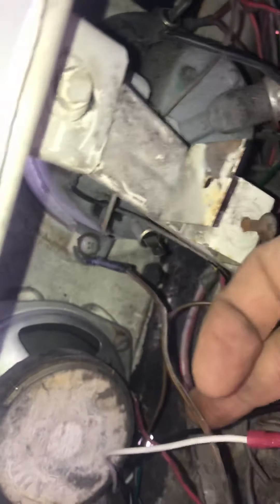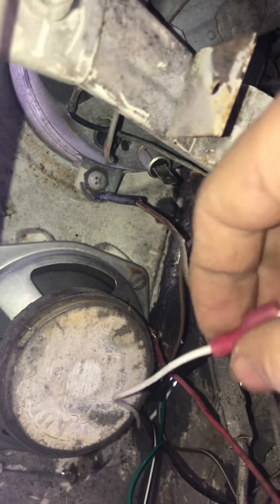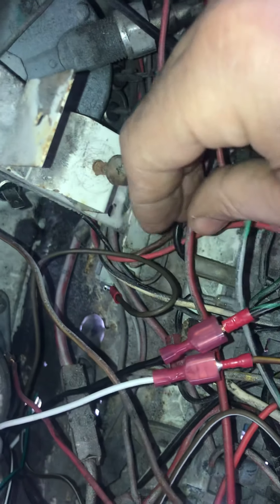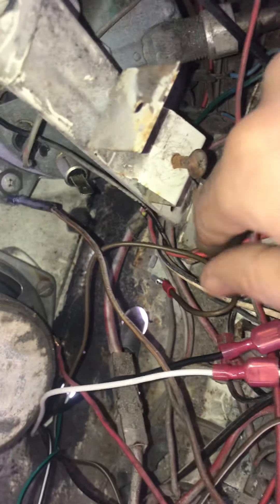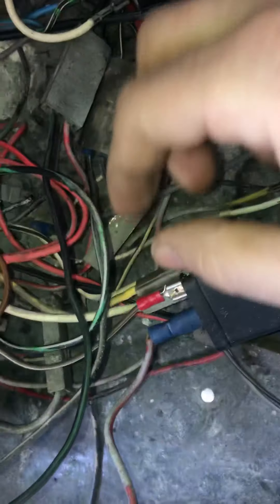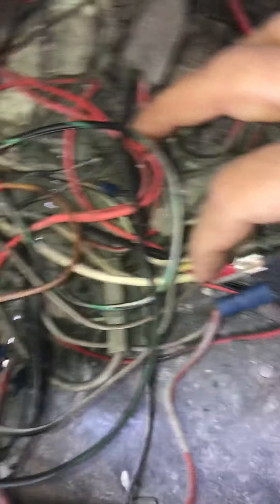The brown went to the white horn wire that comes from the new stalk — that was a bit of a guess. Then I had an earth wire down here from the new stalk, and a brown/white wire also from the new stalk which I connected directly to the relay.